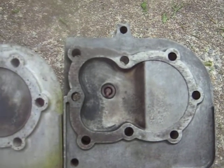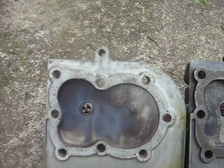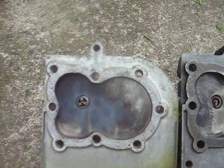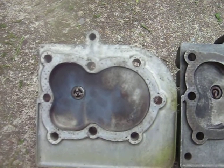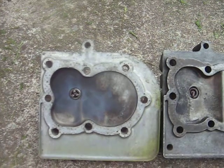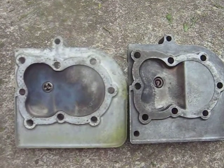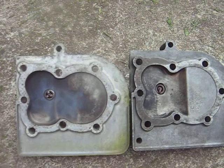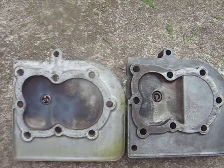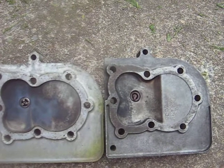As I mentioned, it's not legal for racing or anything, but for just running around your parking lot or your yard or something it should be fine. I haven't noticed any problems with the engines running the higher compression — the piston seems to be able to take it. Just wanted to show you a comparison of the two heads. The four-horse heads may be a little hard to find these days. I come across them at the scrapyard, but they're certainly a lot more rare than the five-horse Model 13.